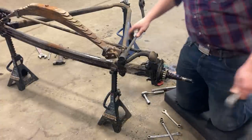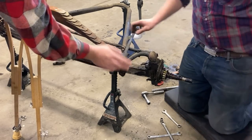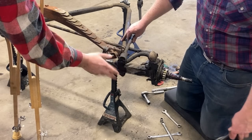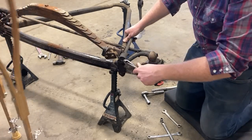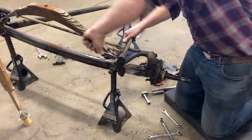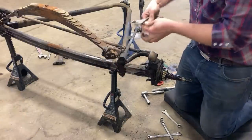Perfect. Break it down to its core components. These Ford early style tie rod ends, they are adjustable and rebuildable. They have a spring in them and a couple of cups and a round ball that they sit on. So as long as your balls aren't flat, rebuildable. No troubles, yeah. Flat balls. Ah, yeah. Looks like somebody's been in this one. Yeah. Instead of a cotter pin, it's some sort of a... Haywire. Yeah, haywire, or mechanics wire, depending. Yeah, farming wire, trucking wire,